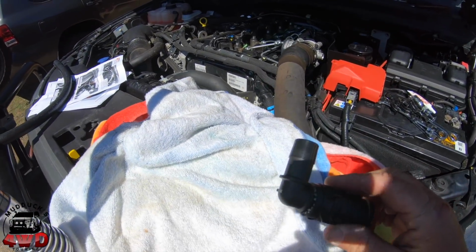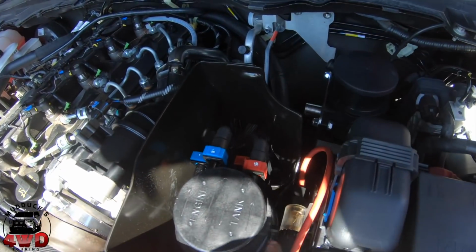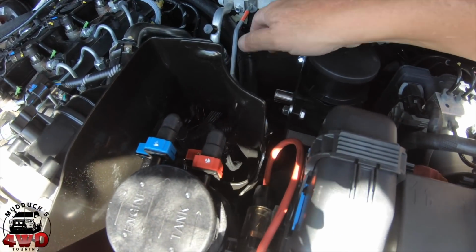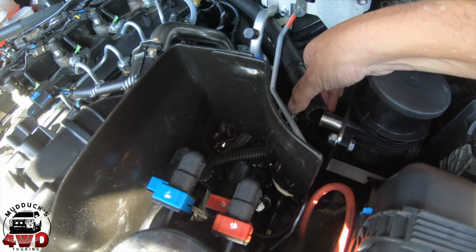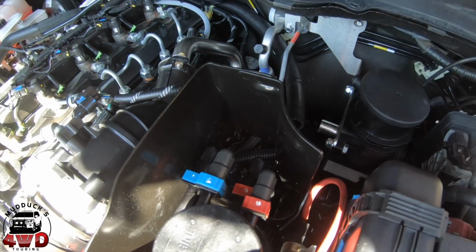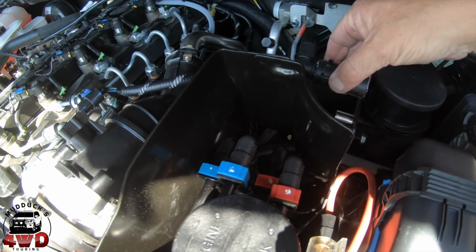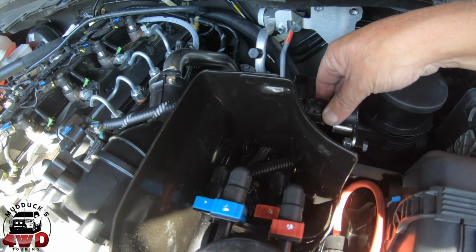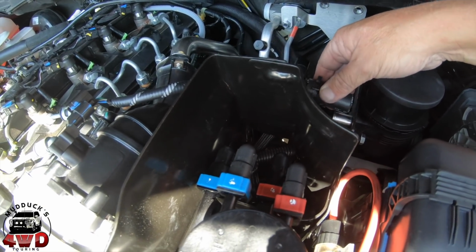Alright, well, I've been away from the vehicle for a while, been down the road. That hose from the crank to this catch can here needs to go that way, and I looked there and went, nah, that's just not going to be practical. So I've ducked down to Burson's, I've picked up that, and I'm going to mount that there, and I reckon that hose will just fit into that nicer, won't be any strain on it.